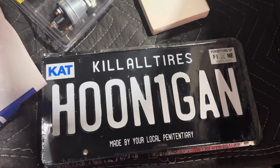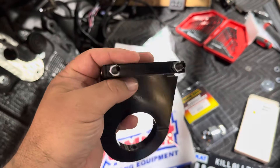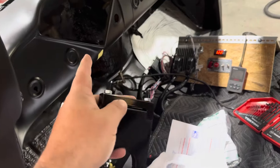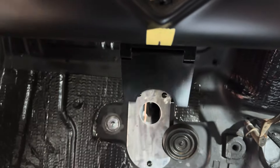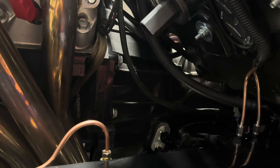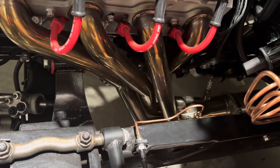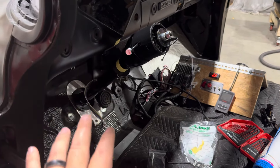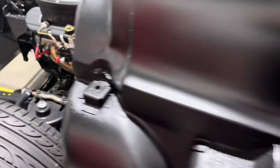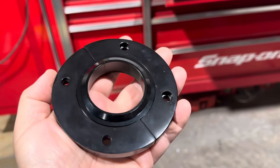We just got back from Summit — picked up a big banner, did some window shopping, picked up some cool swag and parts. Here's the new drop we picked up at three and a half inches — it's all aluminum, powder coated, looks really cool. The bolt spacing on this is exactly what we just drilled out on the dash, so no further modifications needed. That looks a lot better — I like that angle a lot more. When I do my linkage I might get away with just one universal. I think the three-and-a-half-inch drop is probably perfect; if I went with a four-and-a-half then the opposite problem starts — too much of an upward angle going back down to the rack and pinion.